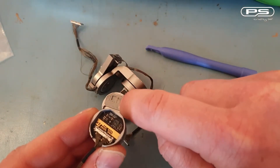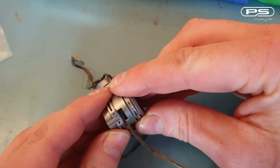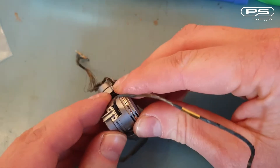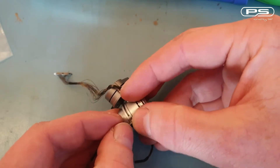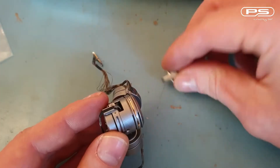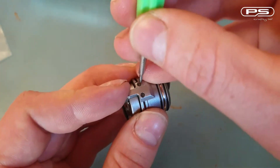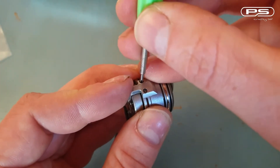The camera board should be making nice contact with the heatsink there. It looks like the sharpie pen mark wasn't necessary after all, but it was good practice anyway. I'll tidy the cable into the channel and carefully bend it down so I can slip the plastic shell back on. Hook it on, fit the screws back in, and fit the tool securing the camera on top of course.